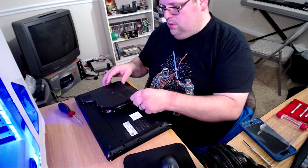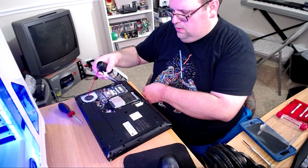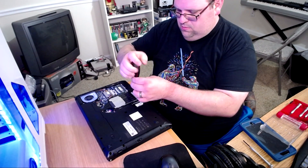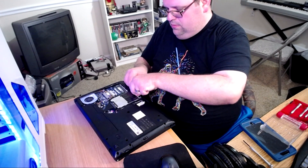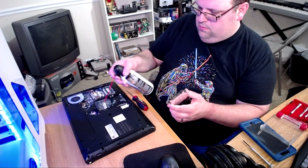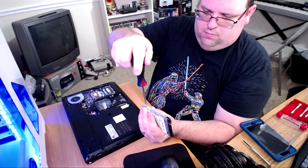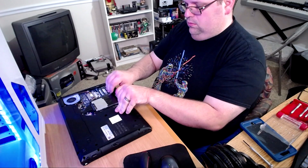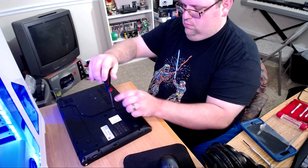To do this, I just unscrewed the back plate, removed it, cleaned it a little bit, removed the retaining screws for the hard drive plate, slid it back and carefully removed it, cleaned it out a little bit. Then I unscrewed the old drive from its cage, cloned the old drive to the new one, screwed the new one in, slid it into place, and replaced the back plate. Let's see how we did.